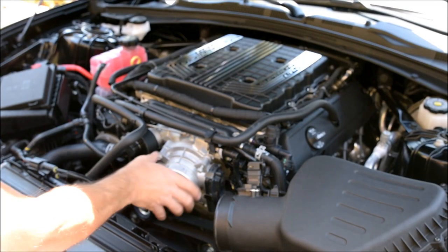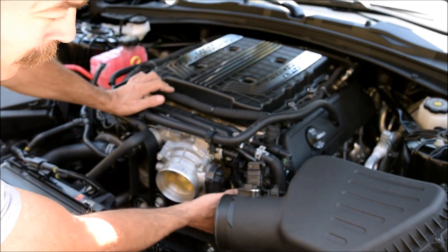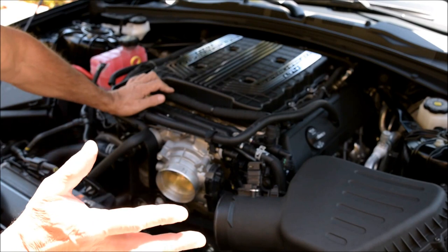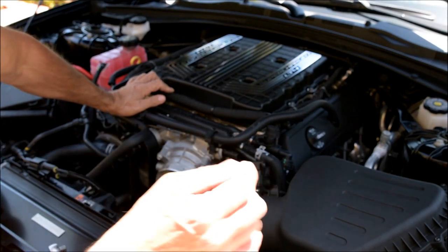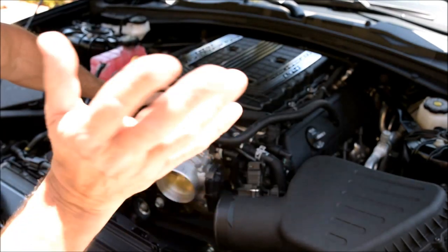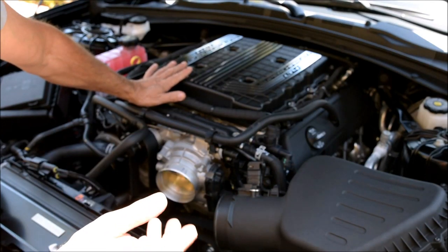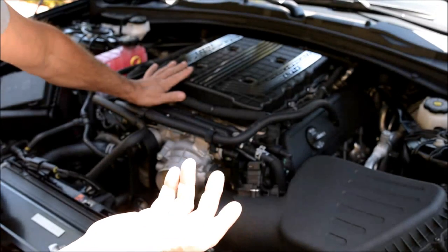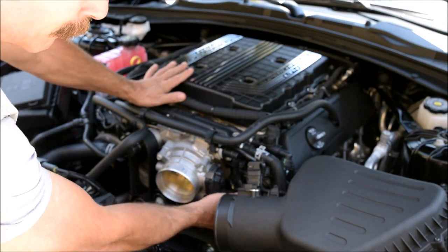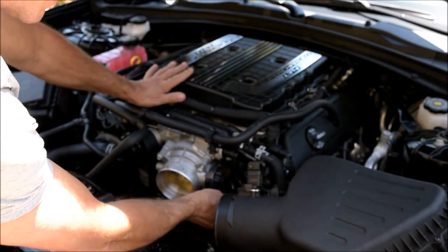Just about got this done back on there. I just wanted to make a couple of points. The electrical connector — anytime I've got electrical stuff off, dielectric grease is just the greatest thing. You put a little bit of dielectric grease on each of the contacts and you're never going to have corrosion or poor connections for 20, 40 years. A lot of electrical problems are caused by poor connections — rain, oxidization in general. Dielectric grease on there and you'll never have that problem. Make sure you push it on until it clicks, then push that little clip back in and it's locked on there.